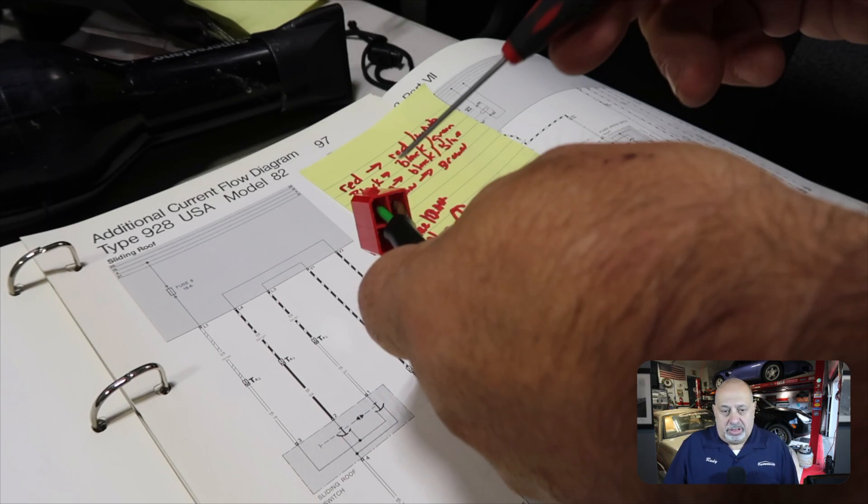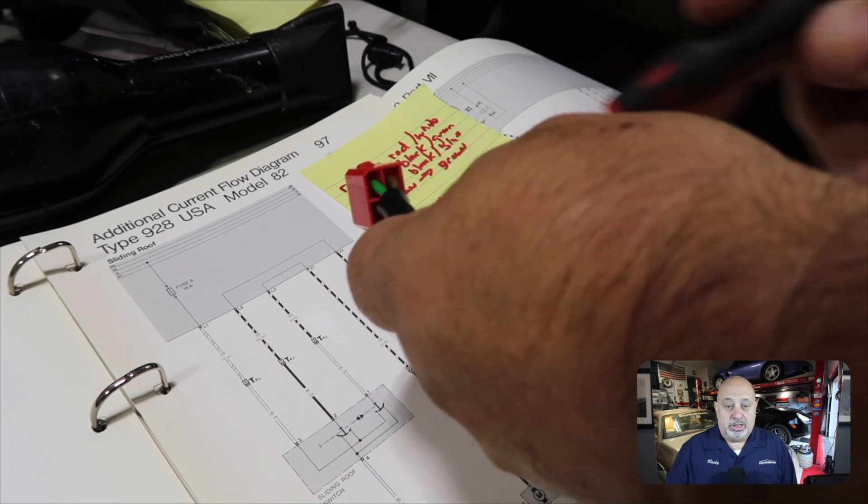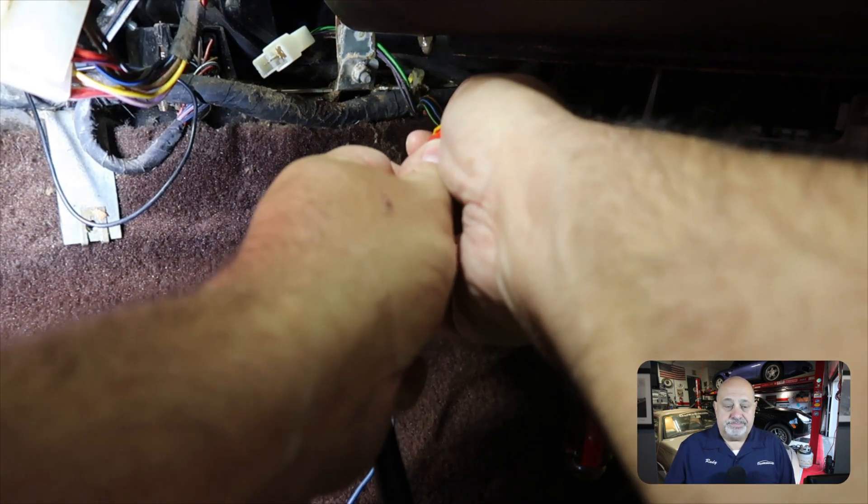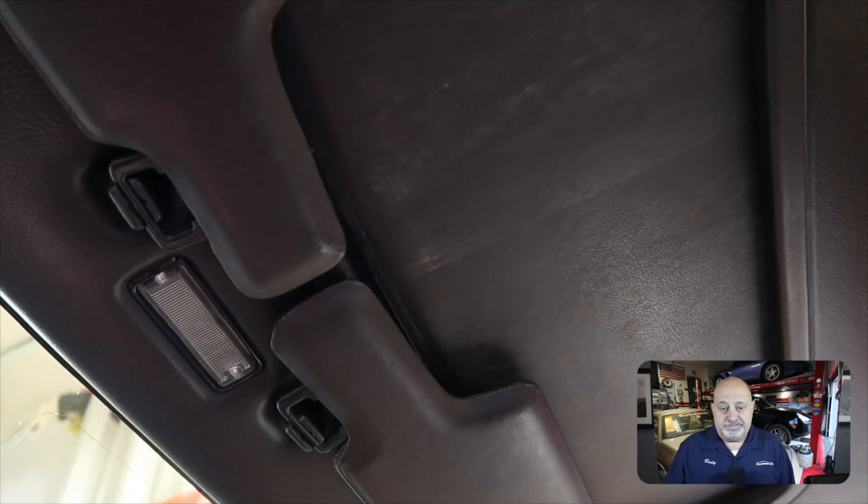Moving on — the same plug type is used across devices: a yellow one for the sunroof, a green one for the passenger side window, and a red one for the driver's side window. It's a four-wire switch — green, brown, black, and red — for all three devices controlled by that one relay. Here I'm confirming the wiring for the sunroof and using the same power window switch I knew was good before I took the dash apart, putting it into the yellow plug outlet, which is the sunroof slot. Sure enough, with the jumper wire in, I could close the sunroof.